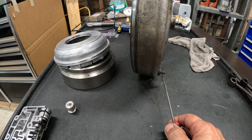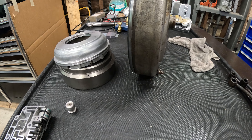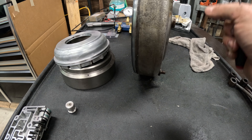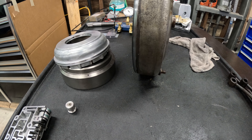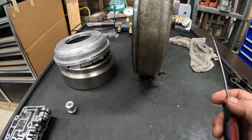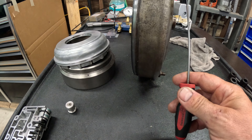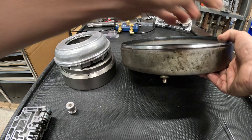The other thing to watch out for is stud length. This is the short stud length, which is good for the one-piece flex plate — anyone with a Power Stroke would recognize that. But some of these older trucks had two-piece flex plates with a really thick steel casting in the middle, and the studs would pass through it. If the studs are short it's a pain to get them aligned and get the nuts on. Normally on a two-piece you'd want the long stud, which just has an extra quarter inch of unthreaded pilot sticking out to help with alignment.